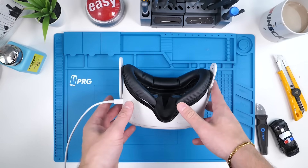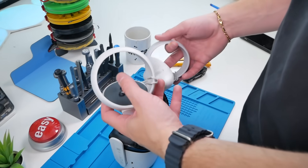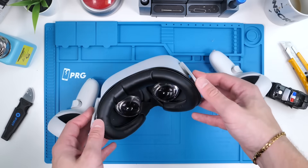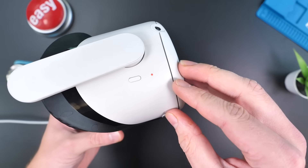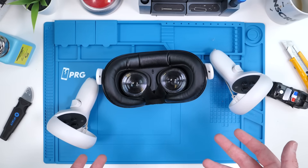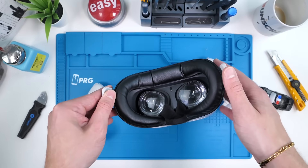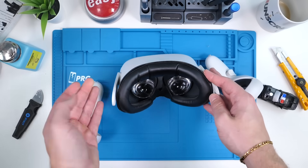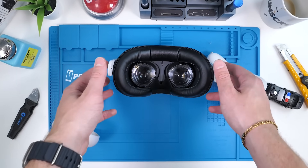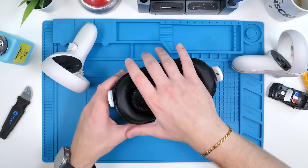I just Googled the problem — a flashing red light means the Oculus doesn't have enough power to even boot. We'll leave it charging for a bit. I drove home to get some controllers to see if everything works, and to my surprise everything does. It charged to 50% quickly, but it's going down super fast — about five percent in the last three minutes just sitting on the home screen. This confirms it needs a new battery.